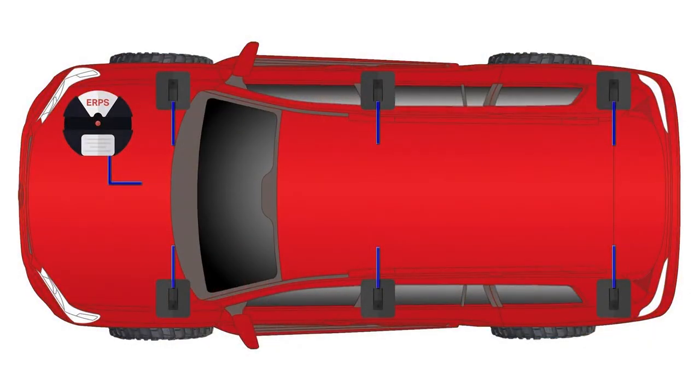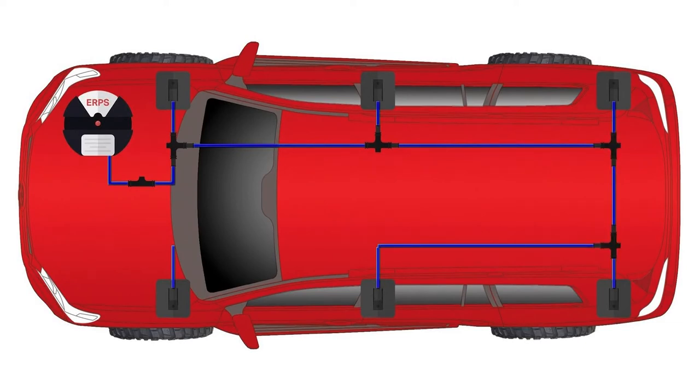Now run the coupler power supply line. Join the coupler power supply line wire — that is the blue wire supplied on the roll — to one of the blue output wires from the generator, using one of the straight wire connectors supplied in the fuse kit. Run this wire to the first coupler and attach it using a T-joiner. Continue running the coupler supply line around the vehicle, attaching couplers as you go. Once you reach the last coupler, return the coupler power supply wire to the second blue wire on the generator. The two blue wires on the generator are bi-directional and can be attached either way.